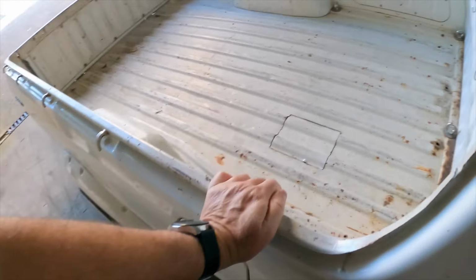So the only thing that doesn't work, funnily enough, is the fuel gauge. It's got 10 litres in the fuel tank, with Shannon's help. Of course, the sender and everything's in there, which is supposed to work. It's calibrated to work with the original gauge, but it isn't. We've just put it in as normal, put 10 litres in there, and the fuel gauge reads full. So we've checked the fuel gauge. There's nothing wrong with that, so it's the sender. There's something up with that.